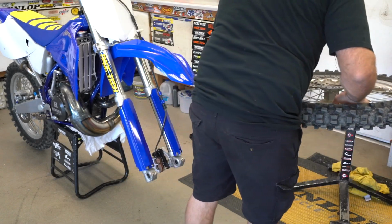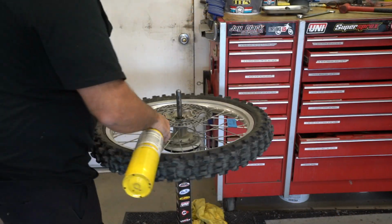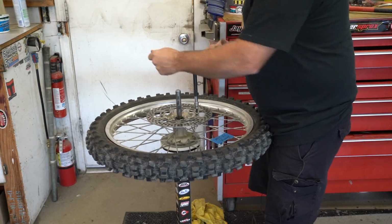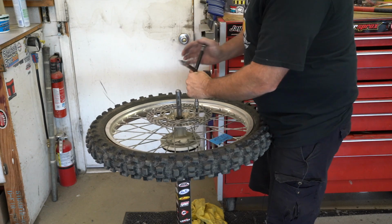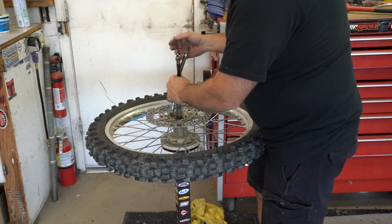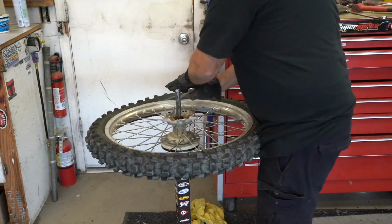Okay, so we start off, obviously, kicking our wheels off here. We're going to take the tires off and rotors and all that. Heat's always good to have on your sprocket on these disc bolts, and then they'll usually come off with some old Loctite. Going to get these disassembled. Of course, we're going to use new bolts. We got some new bolts from Spec Bolt when we reassemble, and we have new rotors from Galfer that we'll put on.